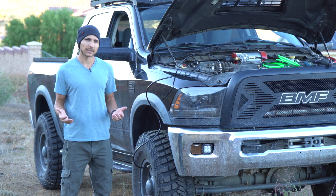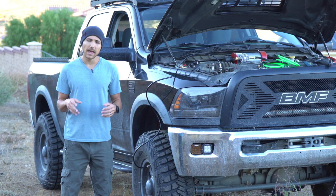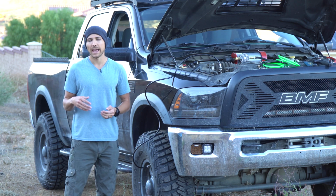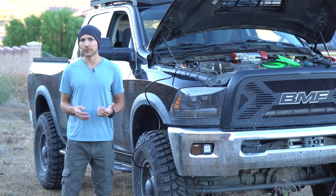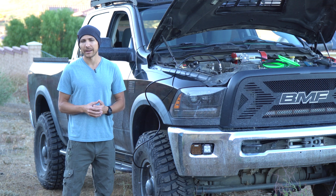Now, using the up-down air system is pretty easy. You have a main control unit and it has a line going to each tire, and then you can hook up your individual tire whips from there, so that way you can air up and air down all of your tires at once. Now, the issue I ran into with the Generation 1 unit is that the tire inflation times were a little bit longer than I was expecting.